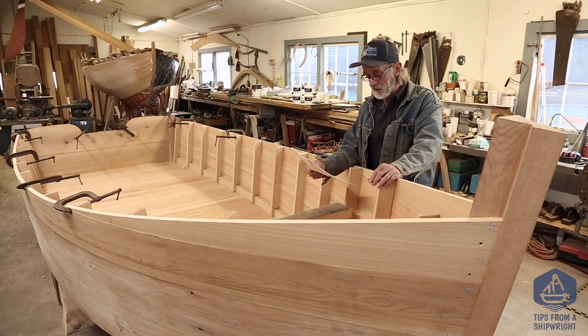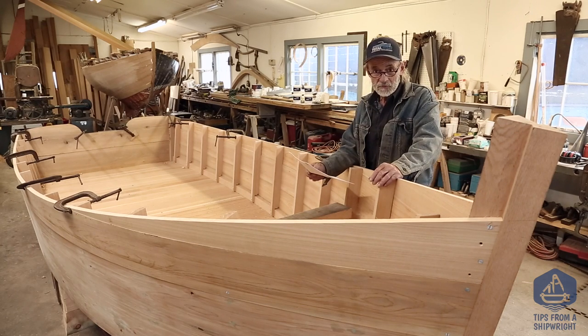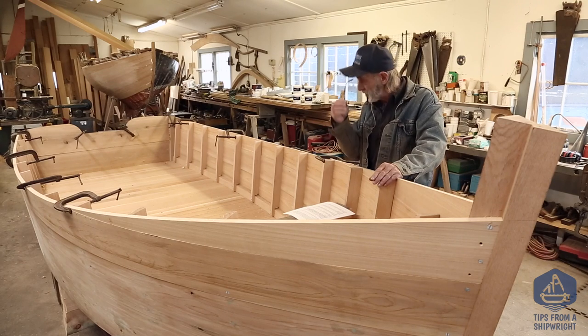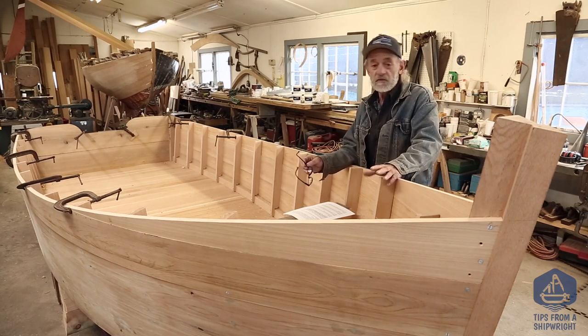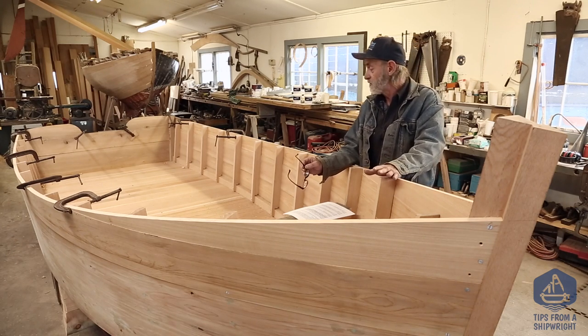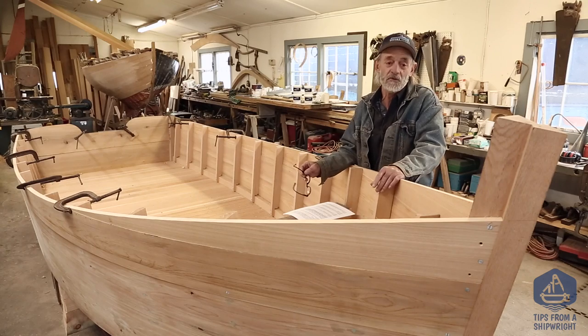From MSY Kasia in Norway: how big of an outboard motor are you planning on having on this one? We don't know that either because I don't want to own the boat when it's complete. But I think it would be really nice to do sea trials with 40 horsepower, or maybe even as much as 60 horsepower. If it were used as a launch in a harbor, it would probably only require something like 25 horsepower. You could even use it effectively with less than that if you weren't planning on planing. It really depends on how much weight you're going to put in the boat — this thing could go from 15 horsepower to 90 horsepower, seriously.